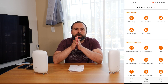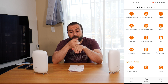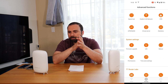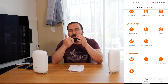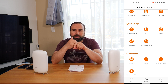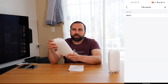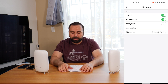In terms of the app, it's actually very easy to use and gives you a good amount of options. You can also make a separate 2.4 GHz band if you want that — it does give you that option. It has honestly a ton of options, more than what I would need personally. You get a blacklist — I'm pretty sure it's MAC address filtering. You get firmware upgrades, you can turn off the LEDs, and you can set up different usernames for the USB ports if you're hooking up a hard drive. You get UPnP, DMZ options, and a whole bunch of other stuff.